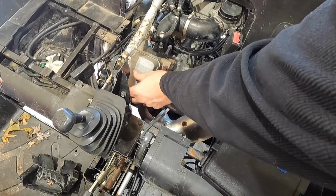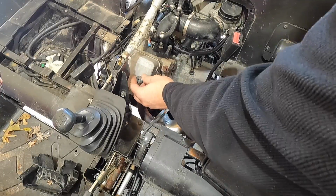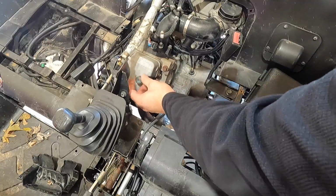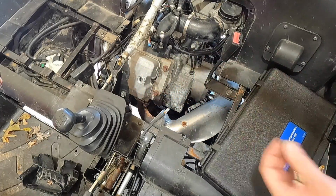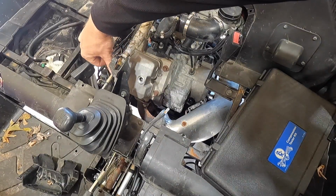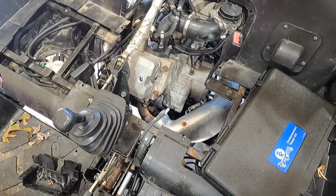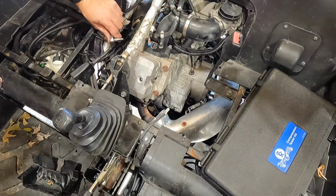And I have an update, like I said before, on the wiring for the electromagnetic deal for the 4-wheel drive, lock and unlock. You can look up the Bennche Spire 800 wiring diagram and just use the new style wiring diagram. You will take one of the grounds and it will be moved.